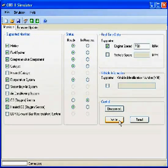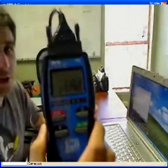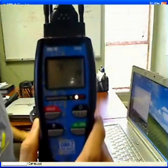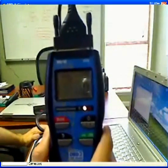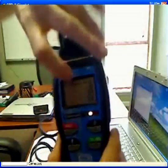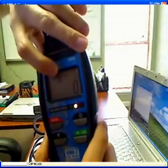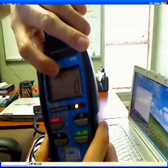Then I'm going to plug in with my code scanner and we're going to see what it reads out. Right now it's reading the code, and in a second it's going to come out. It should have a yellow light, and there's going to be a little blinking indicator up here that indicates that the oxygen sensor readiness monitor has not completed.